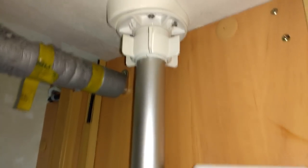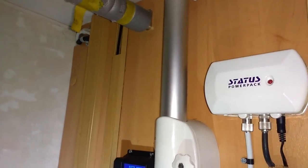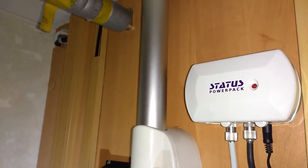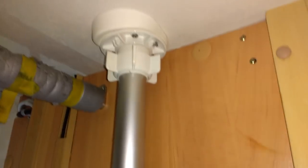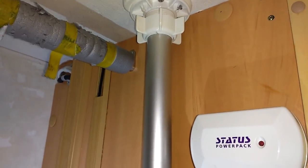That doesn't light up until I put the electrics on for the back of the van. What you actually do is push it all the way up - obviously the higher you need to get a signal. So you unscrew that bit there and push it up. But what I want to do, and I've been meaning to do it for a while, is just centre the actual top of the aerial so I know when it's down it's in a forward position, rather than catching it on the side of the van. So I'm going to mark it with a permanent marker - put a line across there. Let's go on the roof and make sure we're fully aligned. I'll loosen that, align it, mark it, and then we'll sort the TV out.